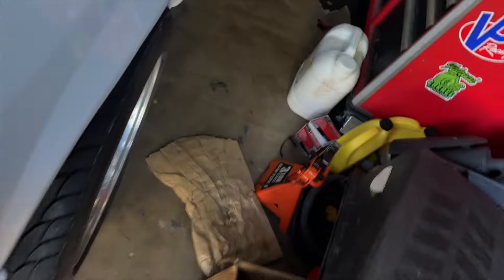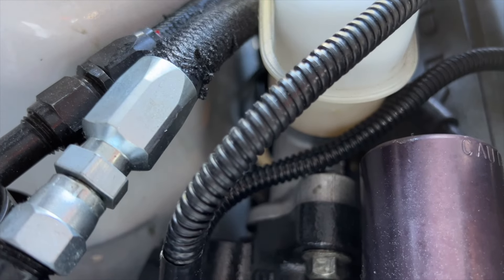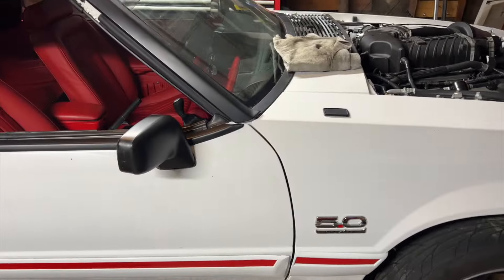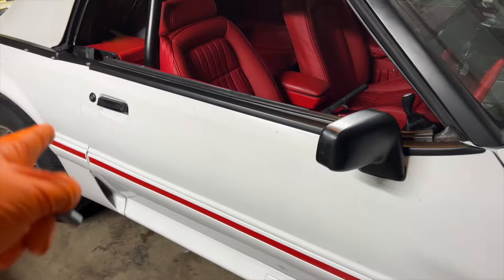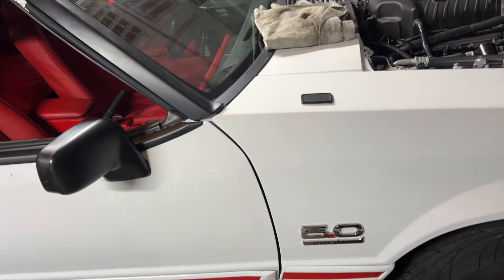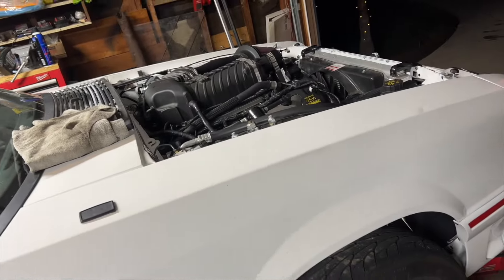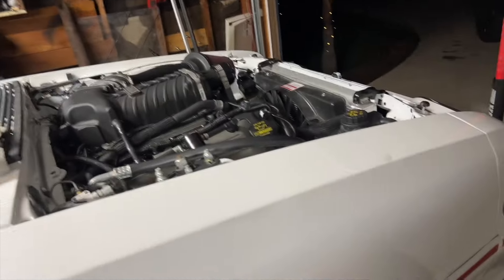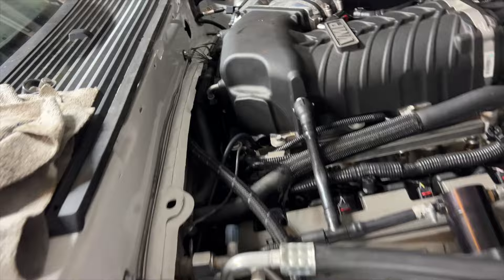It actually only works when pressing on the brakes. Summing up the issues — the reason for starting and then not starting, overloading on the relays: you unplug the battery and it goes back to normal, the relays aren't blown, everything acts functional. Which is weird — before we sent it off to upholstery we got over 300 miles on it, cranking it, firing it up, going to the gas station, stop and start. And then all of a sudden now we have starting issues.